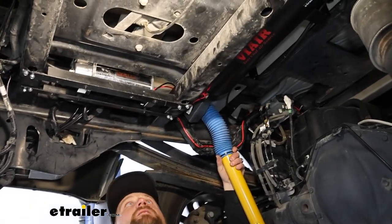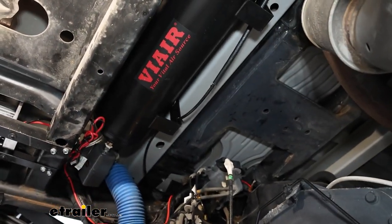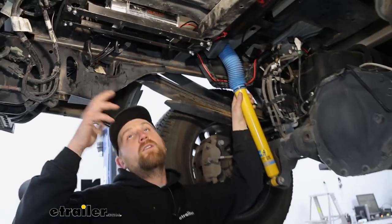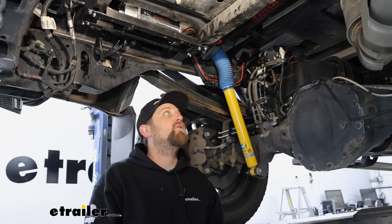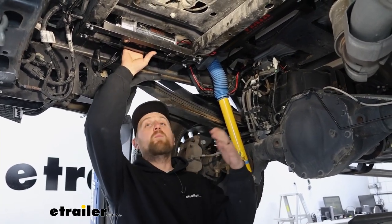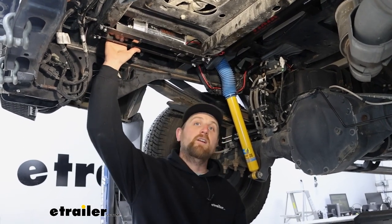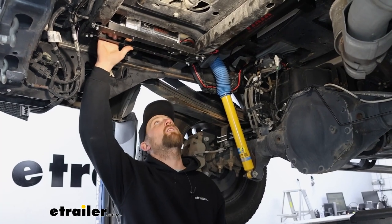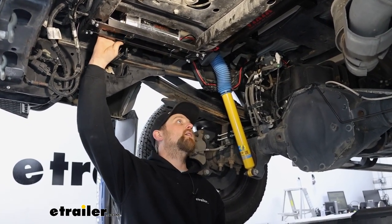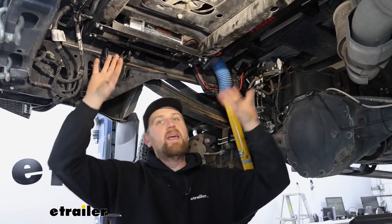Underneath the truck, this is what your kit is going to look like if you install it like we did ours. It's possible to get everything underneath here and still get your spare tire back up — it does fit back up; we just left it out of the way so we can see everything. That's really nice — you're not going to have to take up space in the bed of your truck. There is a particular way you want to mount up your compressor and some of the other parts to the system, so you can't just slap it any which way on the side of your frame. Be conscious of that, because if you do that, chances are really good you're going to end up burning up your compressor.